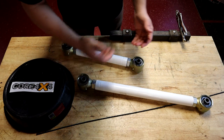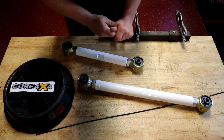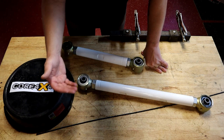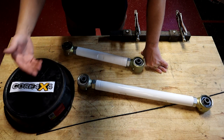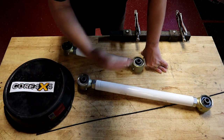What's happening — and a lot of people think, oh man, that rear-end squatting, that's what you want, it's working good — well, no, that's not good. It only works out in your favor if the track is prepped really good and it's sticky, and there's actually enough glue or the track is good enough to get your tire to hook up and push the car forward.